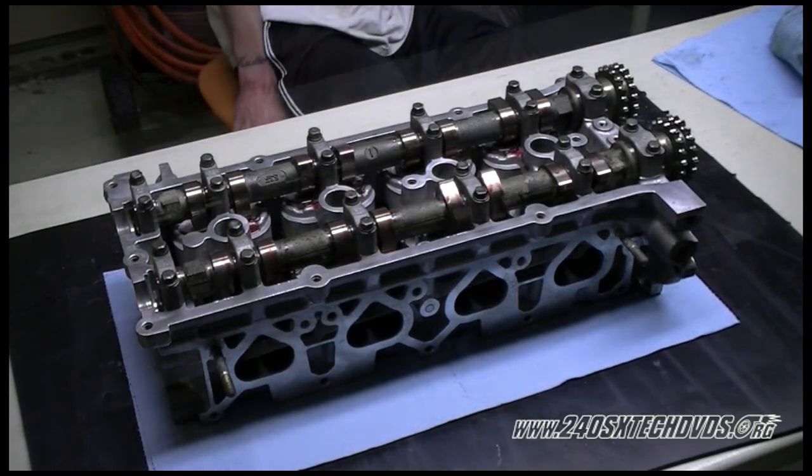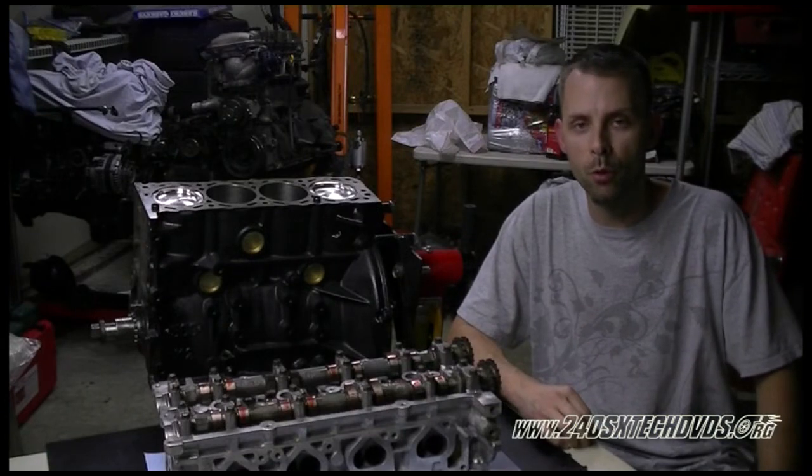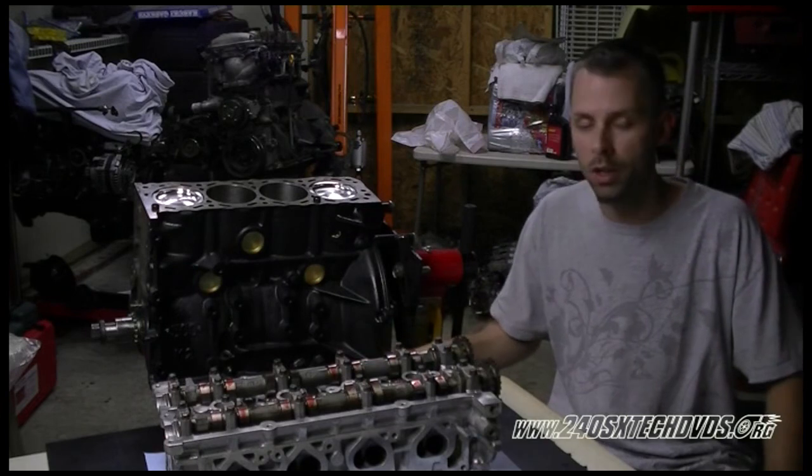So make sure you have all your specs written down and make sure they do not go over any of your specs. And also it'd probably be good to go ahead and mark your cams, exhaust and intake. Just put an E and an I on each one of them for the machine shop just in case they get mixed up. On the next video, part 4 of the motor build video, we'll be installing this head onto this block and completing the long block assembly.